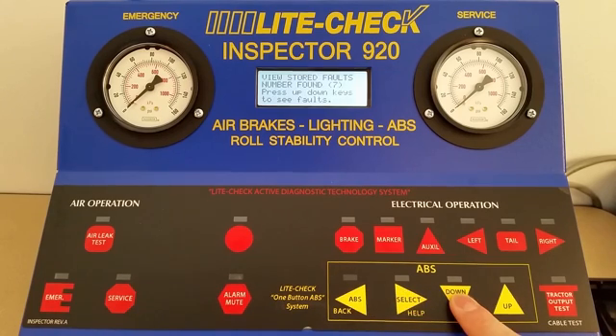The wheel speed special function shows you the wheel speed data from the sensor at the wheel. It'll show you the current and the max speed of the wheel so that you can turn one and see which sensor is hooked to which wheel.